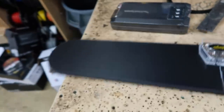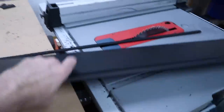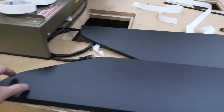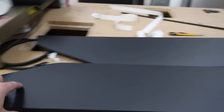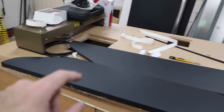that's going to hold all these things. Now the top piece is this guy right here. This is some half inch. We're gonna mount the amplifiers like this. They're gonna sit basically just like that on this piece, and this will be covered in a material. And then underneath it is going to be this guy. It's gonna sit on this. And then we have two more pieces here, which I'm just getting ready to router out this part right here, because we don't need this area. This is where all the wiring is gonna go. And this is two more pieces, so that's an inch thick. So I'm gonna remove that part of it right now, and I'll be right back.